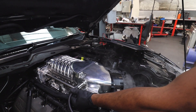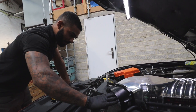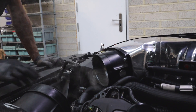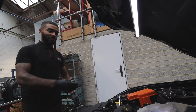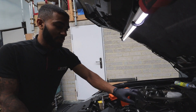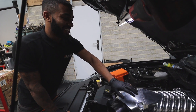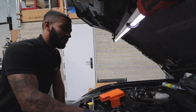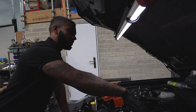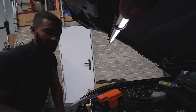No leaks. As you saw, we smoke-tested the supercharger after installing the new O-rings and it actually popped the glove off the throttle body, meaning that the supercharger is now holding the pressure that it should be. It's not leaking out of the sides anymore, so that's all nice and sealed.